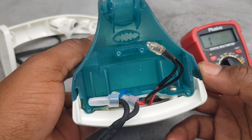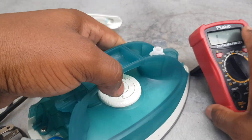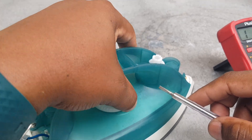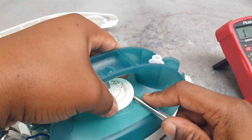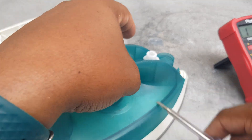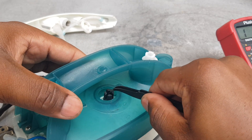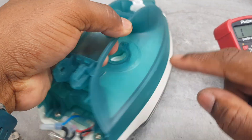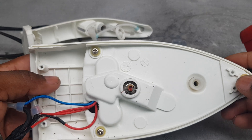The cable is good. I'm going to unscrew these and remove this. I'll show you how I'm going to remove this - put it in the half position, use the flathead to prise it up as you can see. I'm going to remove this metal piece and then this plastic piece right here. Now we can safely remove these four screws and then this can easily lift up. The plastic part is now removed.